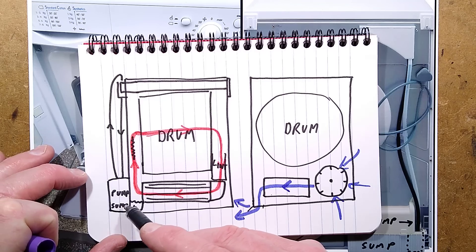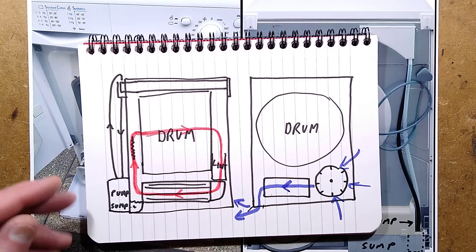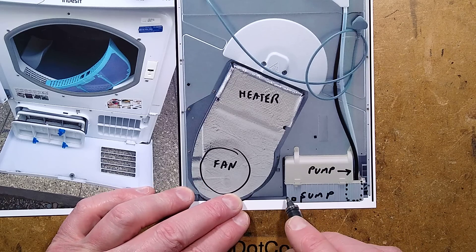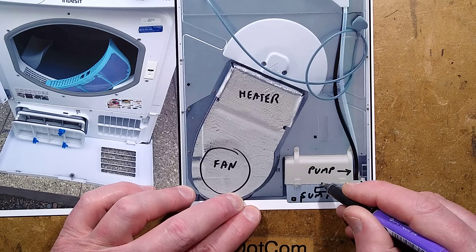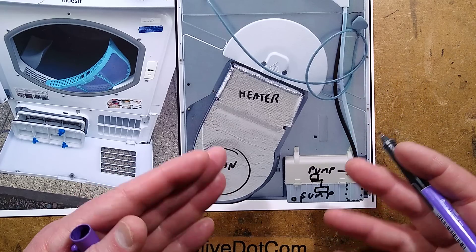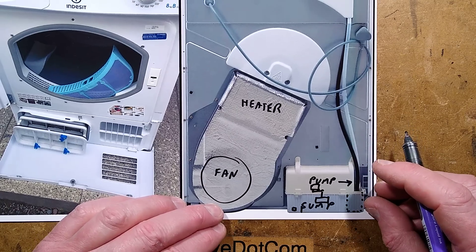The water that's collected goes into a little sump with a small dam in it. It's occasionally worth opening this, though it's quite hard — you have to unclip it and take the panels off. Inside there's a little dam and a channel for the water to come out from the collection area in the machine, and there's an area where the pump sits. There's also a styrofoam float switch that rises with water level and triggers a micro switch. The pump just runs all the time — from the point you turn the machine on, it runs continually. It only pumps water when there is water there, and it makes a rhythmic noise, like many washing machines do when emptying.